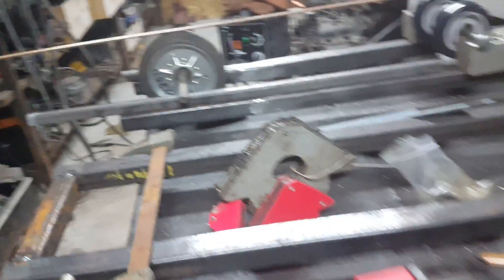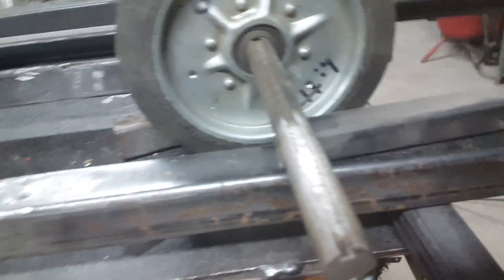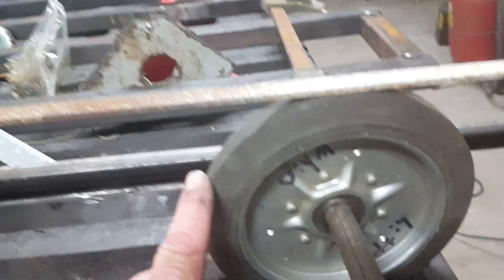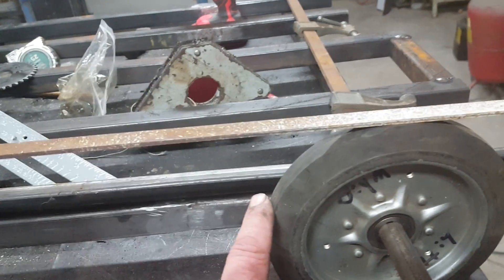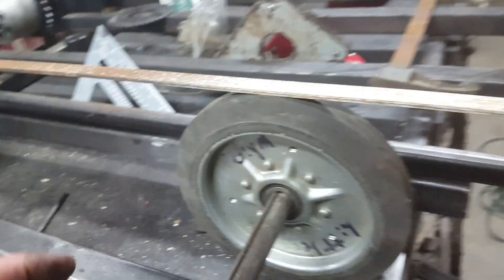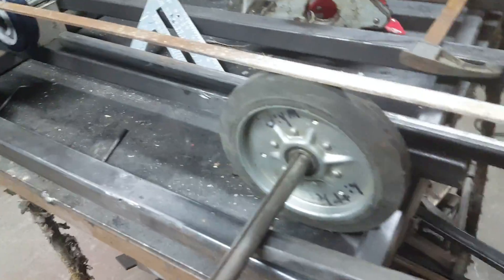The last thing I want to talk about is the idler wheel here. This is number 043511 — I try to give you part numbers and information about it. That one is a snowmobile; it's called a Little Whip and it's a Scorpion. I went to the snowmobile graveyard and I found these idler wheels — the take-up wheels — that I like, because most wheels are really skinny and these were three-quarters and they kind of flare out to an inch, which is exactly what the track guides are — inside is an inch.